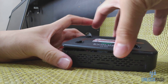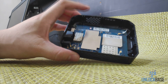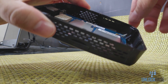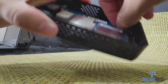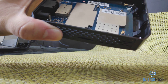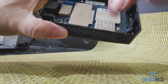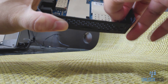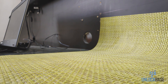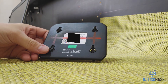Eventually you'll get the back cover off. On this side, go ahead and disconnect these two antennas that go into the internal antennas. The nice thing about this is you don't need to solder anything, so if you want to reverse this mod and use the internal antennas again you can actually do that. Just do it gently and that's disconnected.